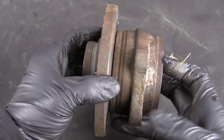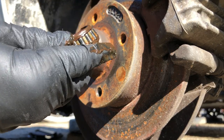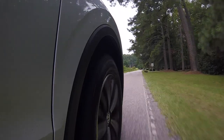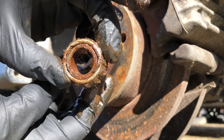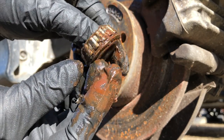This one here is one complete unit that bolts onto the car, while this style is individual pieces that need to be assembled. When it comes to wheel bearing failure, the most common thing is going to be noise. This noise can come from a variety of things. What might seem like a slight impact to the wheel can cause damage to the bearing. Moisture getting behind the seal inside the bearing can contaminate the grease and cause it to overheat, and like anything, improper installation can cause premature failure.